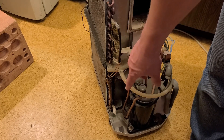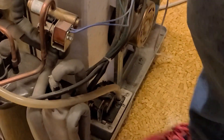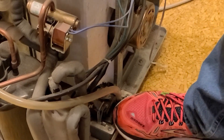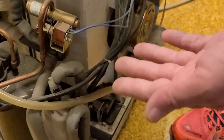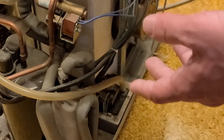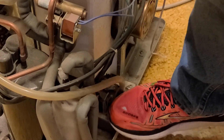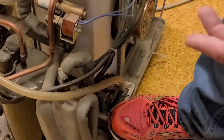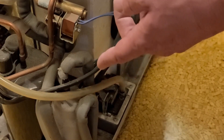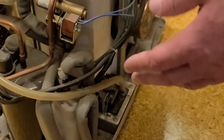This thing right down here is a centrifugal dehumidifier — this is one of those air conditioners that's had this feature for about 15 years where there's no need for a drain hose; it puts the water out through the exhaust. A motor-driven spinner mists up the water and this little tube is supposed to go along with the exhaust fan to get sucked out. The problem was that this pump motor was the first failure — the mister motor overheated, melted, and jammed up in the plastic. This thing could have used some improvements.